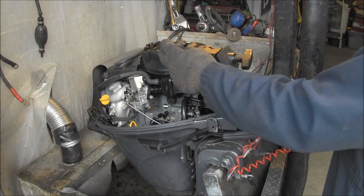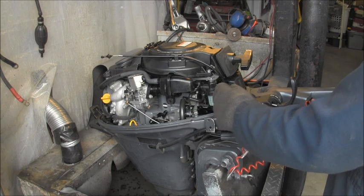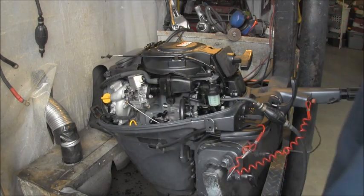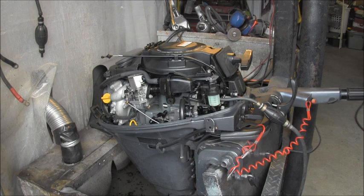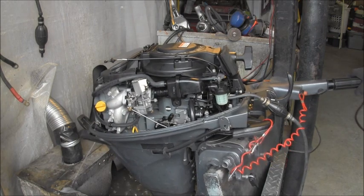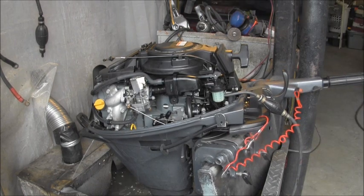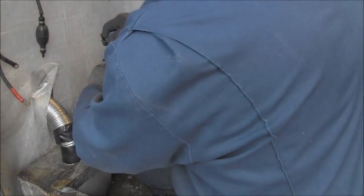Also, this safety interlock cable, I will discuss it with him, what he wants to do. But if this throttle has even the least little bit of throttle on, it'll engage this dog. I've got it wired so it can be started that way, but I will put it back the way it's supposed to be. But I'm going to go ahead and see if this thing will... There you go. I wanted it to burn out as much of that oil as we could.